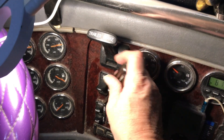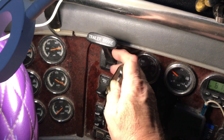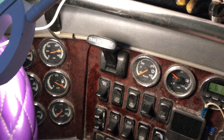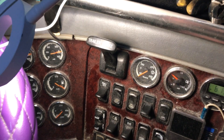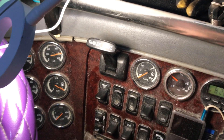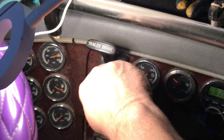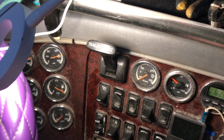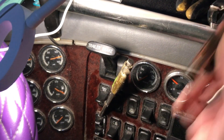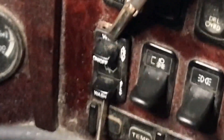The first thing I do is take a screwdriver down here — the switch has a little tab, like I showed earlier, which you can see on this one. Take a flathead screwdriver and wedge it in there, then pry that top end out a little bit. Then I take my small vise grips and stick them on the top end, because as soon as you try to push the bottom end out, the top tab is going to close again on you. So clip the vise grips into place to hold it from sliding back in. Hopefully that'll stay as I pry the bottom end out. Now we try to get that tab loosened underneath and pull the switch forward from the bottom.